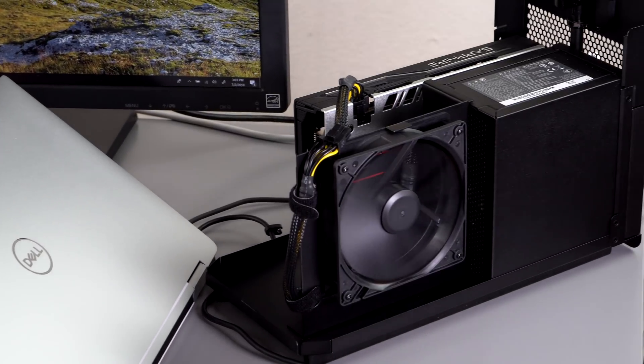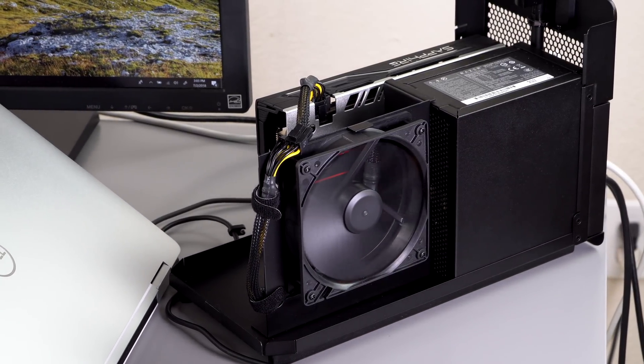This one goes up to 100 watts. That said, Razer also sells a two-meter cable that's only rated to do 65 watts. So if you want the 100 watts out, you're going to have to go on Amazon — there's Cables Matter brand for about $60 and Belkin for around $70 if you want a longer cable.